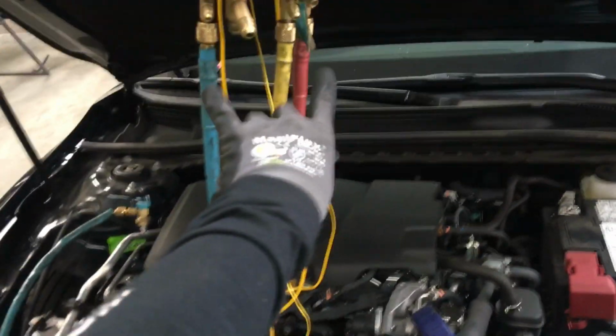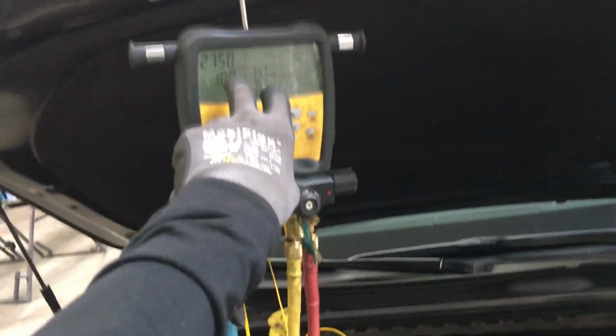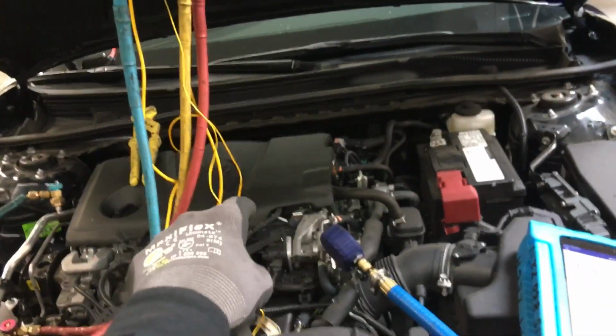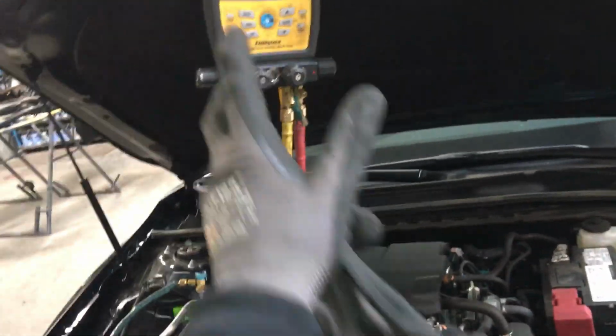So remember I said when this was hooked up here, the capability of the rubber hose. When I had the vacuum pumps hooked up to the refrigerant hoses, isolated just through the manifold, on old refrigerant hoses that have ester oil in them and are contaminated, it was having a hard time pulling below 700 microns, because that's real world. Not laboratory, not brand new hoses that I put in a vacuum chamber and leave down at 10 microns overnight to dry out the rubber, and then do tests.